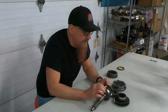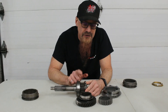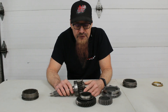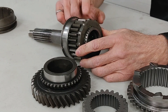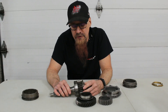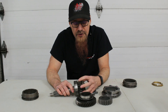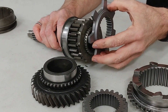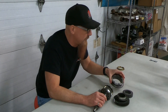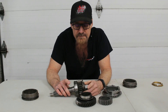In theory that's what was supposed to happen. It's been a couple of videos since there's been a major fail, so here we go back to Ed's usual fail. This gear won't come off the input shaft, and neither will the bearing, and neither will the snap ring. This whole assembly has fused itself together. With my five-ton press, heat, and shocking cool liquid on the input shaft I couldn't get this thing apart, so I'm probably going to have to order a whole new input shaft and there goes the budget. In an ideal world it would slide off, the new gear would slide on, the face-tooth assembly would slide on, I'd pop the snap ring on, throw it back in the transmission, replace the fifth-reverse slider with the face-tooth slider, and we'd be off to the races.